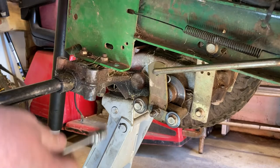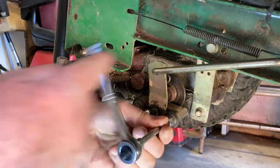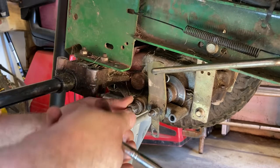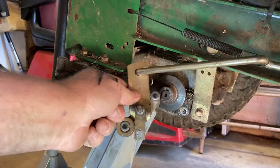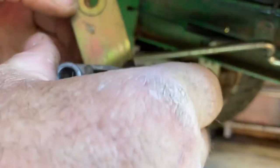There's going to be two little pins in here. Take that off. All right, my parts are already falling down. You got these two little pins here. I'm going to bring this around so you can see it. I'm going to pull this off — they go in these two slots here, and this cam will be pushing on them to push the brake shoe in.